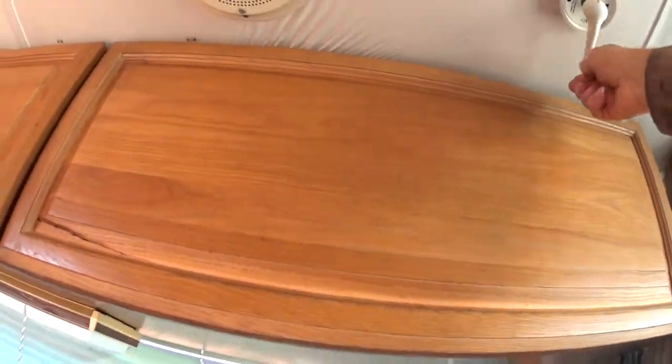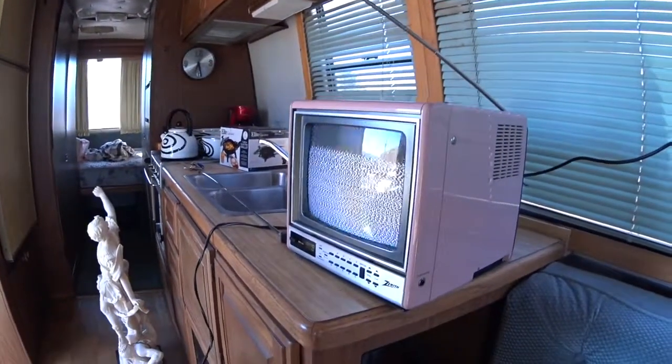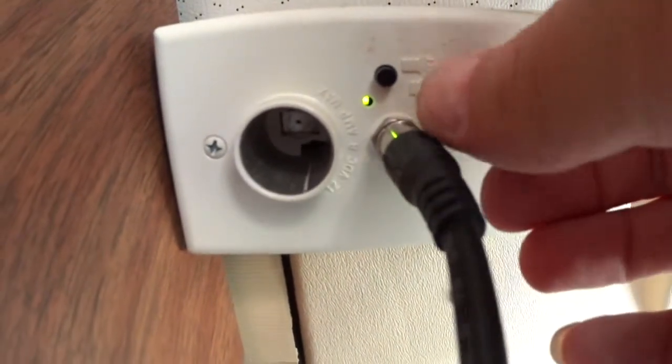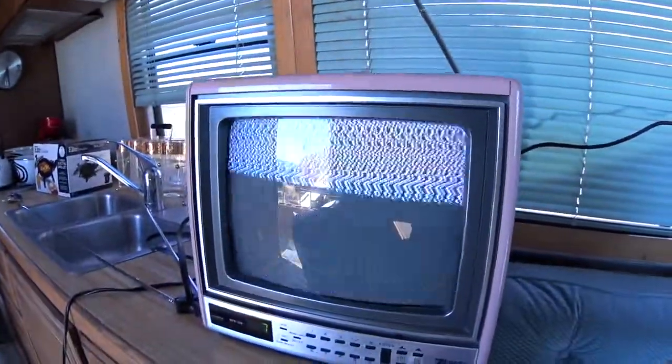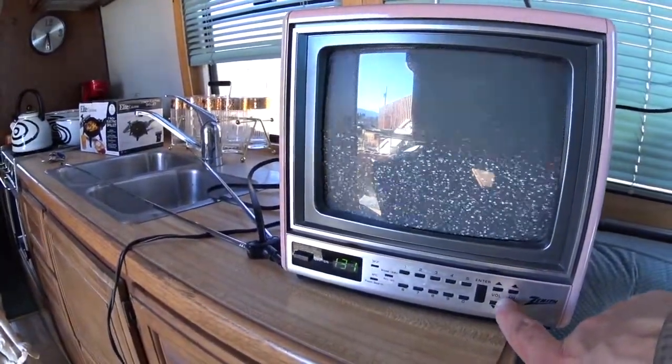Let's raise the antenna. I just wanted you to hear that because no matter how big your antenna is, you're not going to get any channels because they have converted over to digital TV. So just to make sure you know how this works: the ATSC digital converter box receives over-the-air ATSC digital TV broadcasts and then gives it to your analog TV. That's what the box is all about that you have to buy.